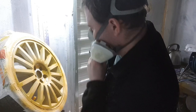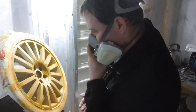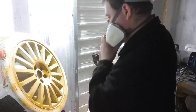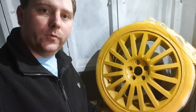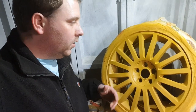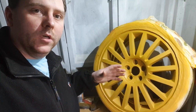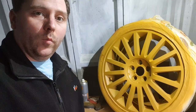I'm going to give that a couple of minutes — about 10 minutes — let it tack off, give it another coat, sand it back, and then put some normal primer on it. I'm already seeing an improvement. I'll give it another couple of coats leaving 10 to 15 minutes between each coat to tack. This is going to be the final coat of filler primer — I'll leave it for about half an hour, sand it back, put some grey primer on inside and out, probably leave it overnight so it fully cures, then sand it back with fine sandpaper for a really smooth finish, and then put the base coat and clear coat on. So far it's looking a hell of a lot better than when I started.